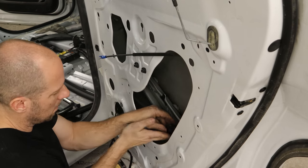Now we're going to check everything for the safety test — make sure it's going to pass. Our headlights work, our wipers and washers work, bright lights work, left turn signal, right turn signal. Let's check the back: brake lights, parking lights, reverse lights. We're good.